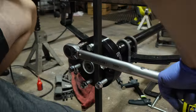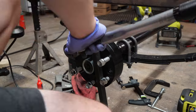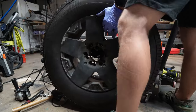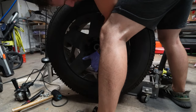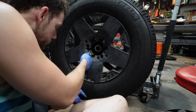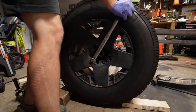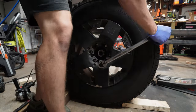Wedge a piece of metal between the lug nuts — not on the studs — to save your studs and threads. After that, mount your tire. Use the same lug nuts that came with the kit because that's what fits. Hand tighten them to get them started, then use your drill. Then drop your tire down to the ground, use your torque wrench at 75 foot-pounds, and make sure everything is torqued in a star pattern.